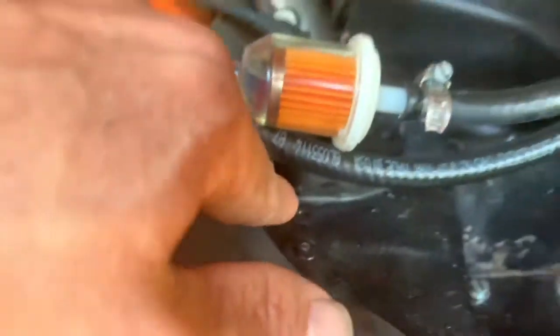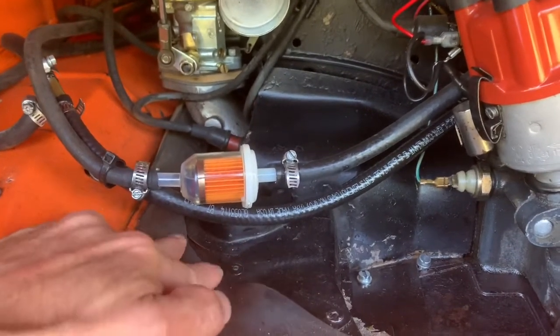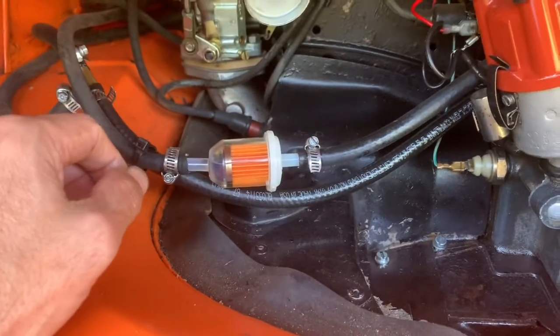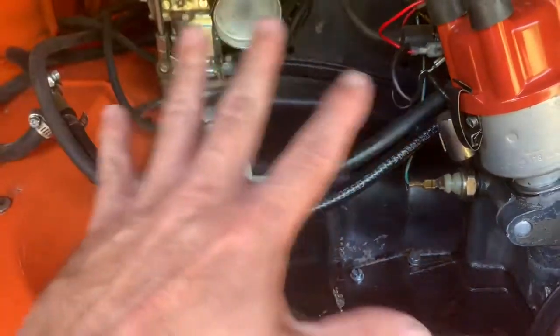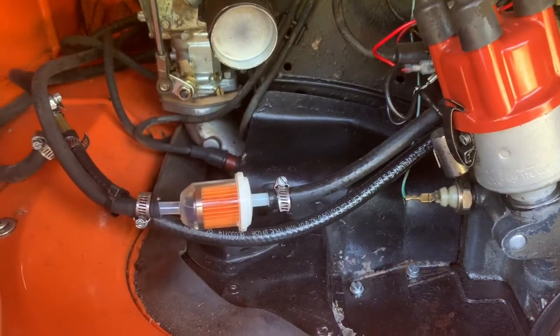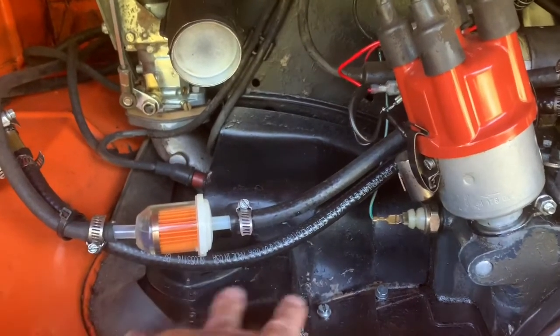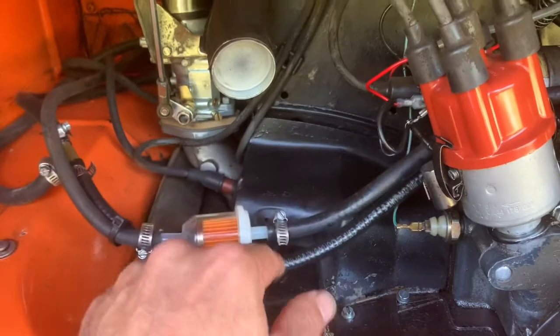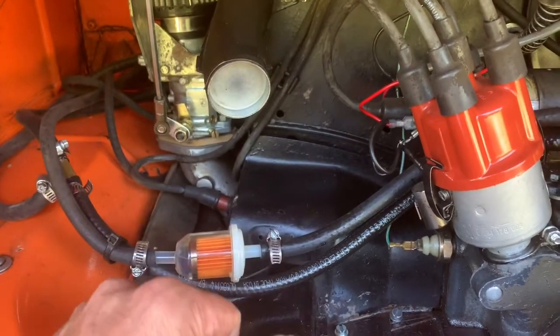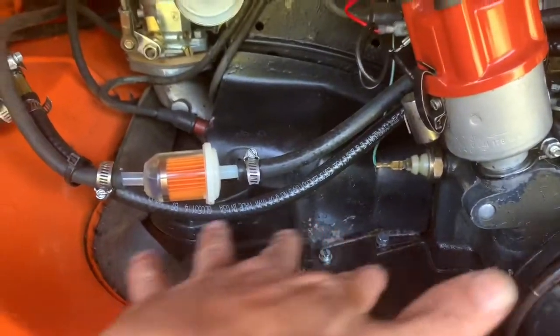Another thing was this seal — it has two lips to it. As a newer owner, both lips were on top of the tin and there was a big gap, so heat could easily get through right where my fuel lines were. When I properly applied the seal so the second lip sat underneath the tin, temperatures instantly went down inside that area. So number six is all about keeping the area cool, because heat can radiate up through any weaknesses or holes in your tin and heat up your fuel lines. Plugging those holes and getting the seal on right made a big difference.